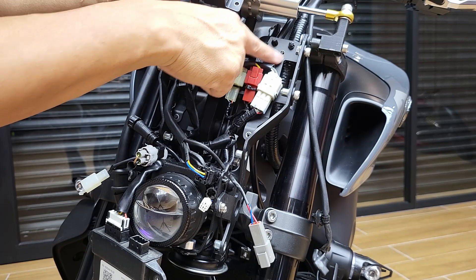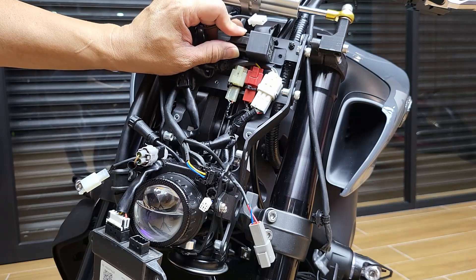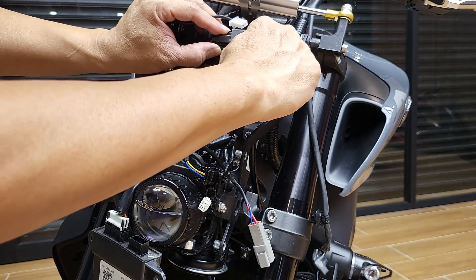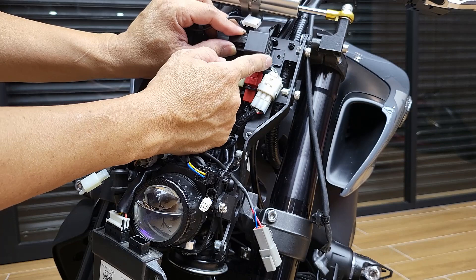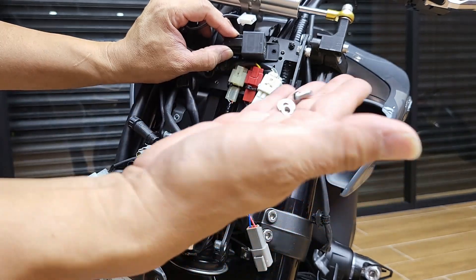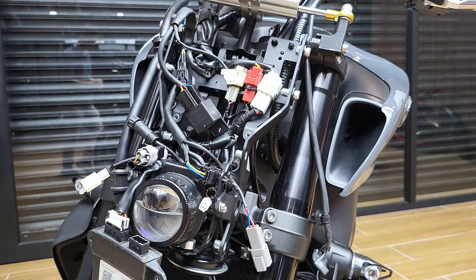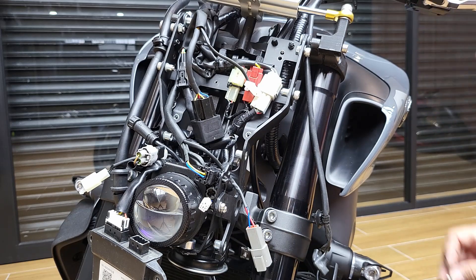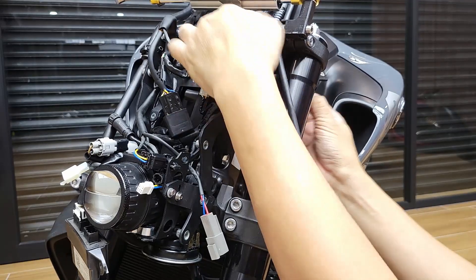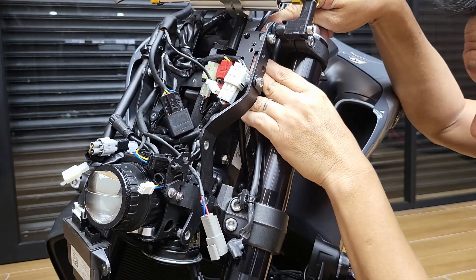Initially there's no hole here. I had to drill a few places to find out. This is where you want to locate the relay, as close as possible to this particular socket. Just drill a five-and-a-half to six millimeter hole — there'll be a bolt supplied with the kit. After drilling, the easiest way is to put the bolt from the front. It's a bit hard to put in.